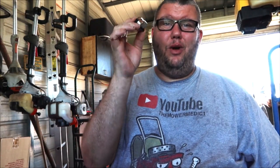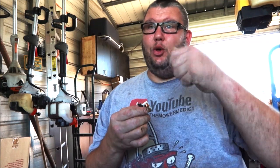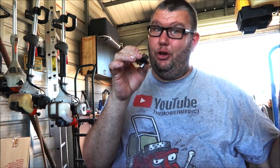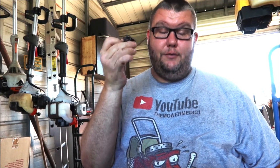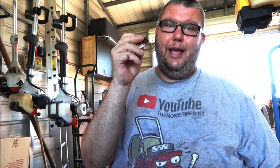So what are these little gadgets and what do they do? Have you ever ran a relay race in school where you run with a flag and then a hundred yards down the track you hand your flag off so you can take a rest and they keep going? Well, that's exactly what these are designed to do. You have a low-amperage circuit that runs to the terminals here, and then off the bigger terminals runs an electric clutch or your starting system. They even use these to run a ground system for the kill system or the safety switches on lawn tractors, zero turns, etc. Basically, these are a high-amp switch.